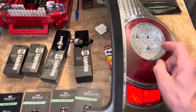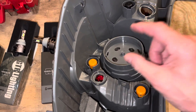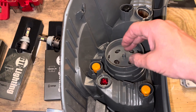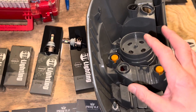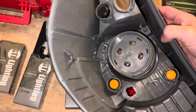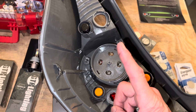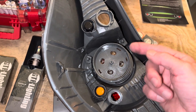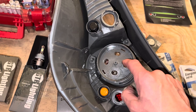One other video coming up later: the Prius brake lights. It's a special unique proprietary assembly and I will be doing a video on how I modify it. The Prius brake light is really pathetic — people can't see you in the dark, people drive up on you and don't see you, might be distracted by their cell phone. The factory OEM Prius light bulb assembly is four LEDs and only one watt. So what I'm going to do is take off the individual LEDs on the module and replace them either with three watt, five watt, or ten watt LEDs.